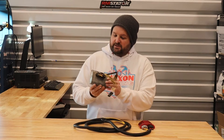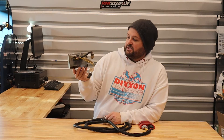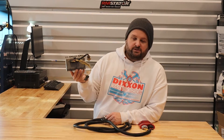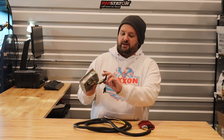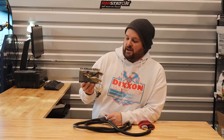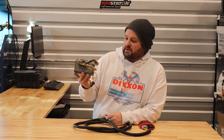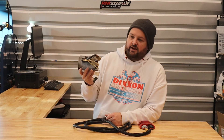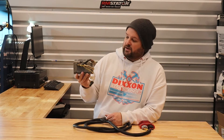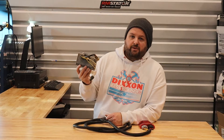If you're familiar with this, here's the most recent version of the SurePower module. It's a silver box. The older versions were a black box, but they all had the same connectors out here on the end, and they mounted up front on the ATV in front of the headlight. This module did a couple different things — they combined the voltage regulator rectifier in this box along with circuit breakers and the fan control for the cooling fan, so you had a lot of functions combined in one unit.